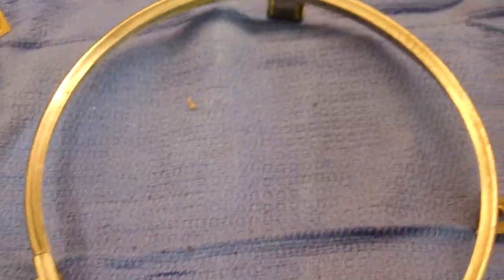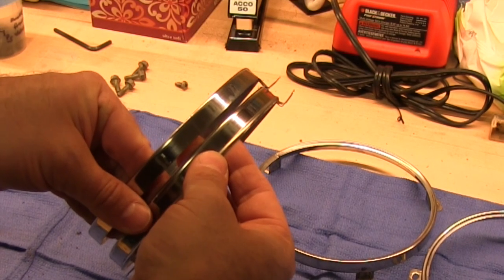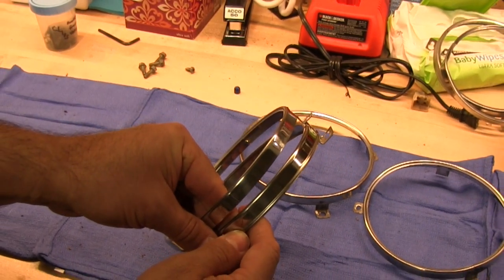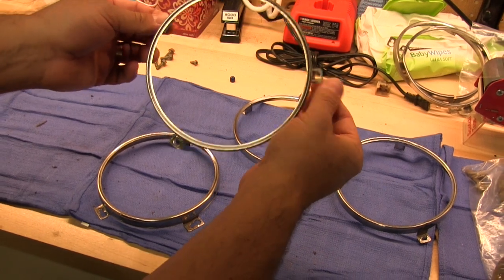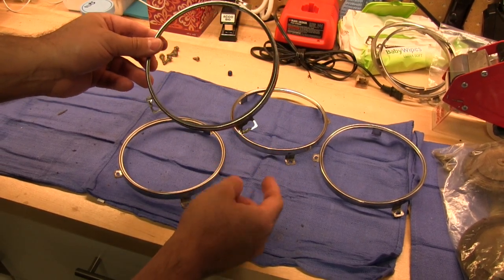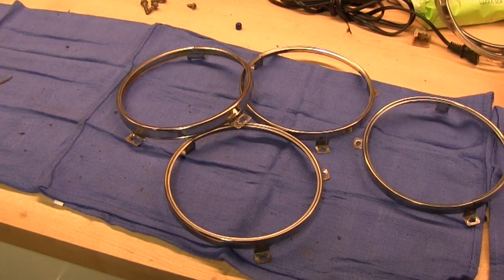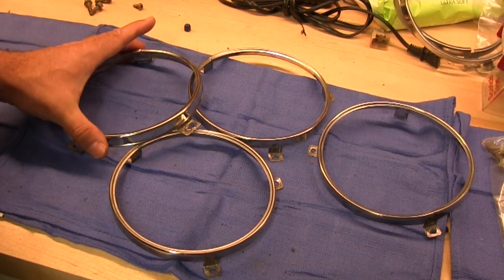This old bezel that got thrown by the wheel — I could probably fix it, but I had extras in the other garage. Here's an interesting note about headlamp trims: notice these are flat. The ones from my storage shed, which came off probably '73s or '74s, have an extra ridge at the bottom. Also, the mounting on the '76s just has holes exactly where they go, while on the early models there's an enlarged hole and you rotate it into position. That's the difference between early and late models.